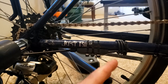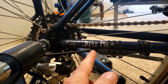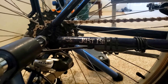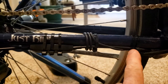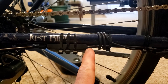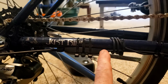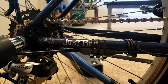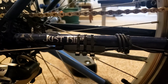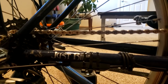What I did was mount one side of the gear sensor right up against the cable stop brazed onto the frame, which holds the casing from the other side. Then I cut off a piece of spare casing, ran it up and into the other side of the gear sensor, and used the little seal that fits on the end to keep water out — that was my main concern, since without a seal water would get in and probably ruin it. I held everything in place with zip ties and it works really well: smooth shifting with no problems, and the motor shuts down cleanly during each shift.